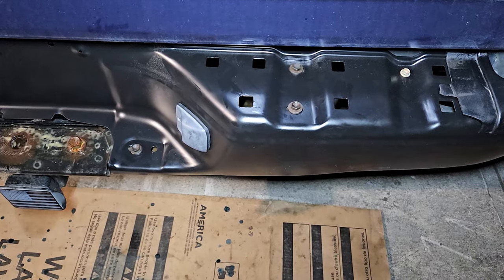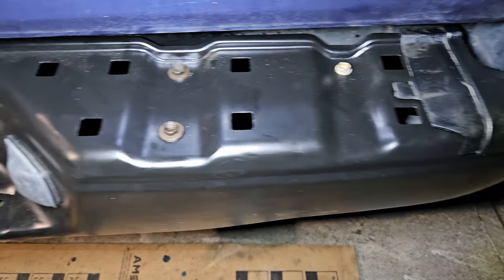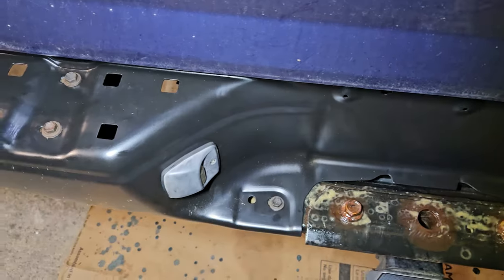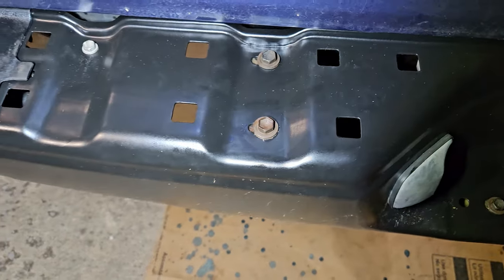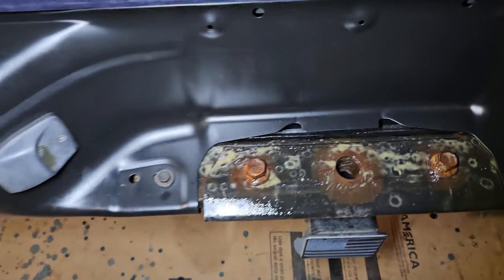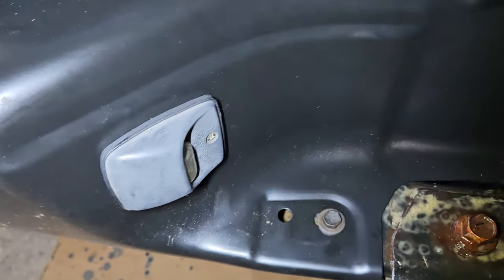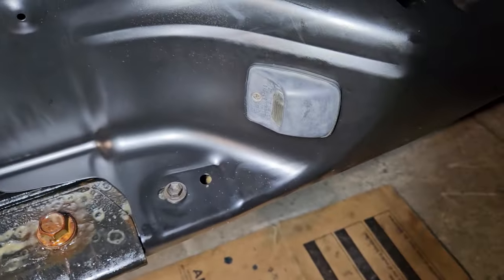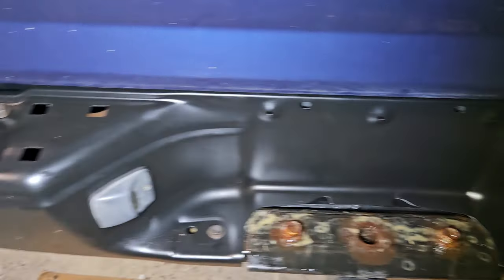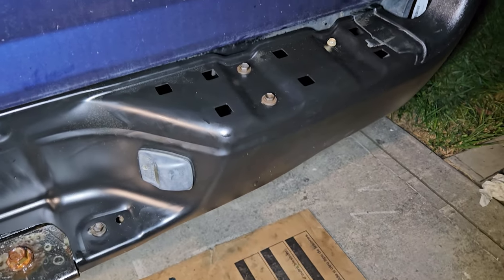I've put a lot of penetrant and some protective oil on the metal bracket on the bumper. We're going to slide this new bumper right on over those big bolts and start putting in all the 12mm bolts, then tighten them up after they're all on. Installation is the reverse of removal. 12mm bolts are in place, snugged them up after all were in. New bumper is looking on — that fluid film made it real easy to slip the new bumper on. We've also put the license plate light pieces back in. Now we're going to put the center plastic piece on top, and that's it.